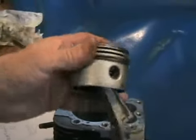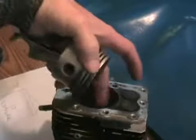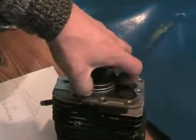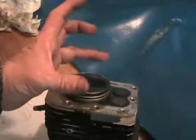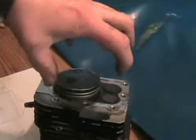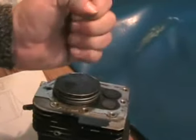Whenever reinstalling a piston in any kind of engine, lubricate all these moving parts, lubricate the wrist pin with motor oil, put some motor oil on the cylinder, and reinstall your piston. You'll need a piston ring compressor — some look like a pair of pliers. If you want a redneck method, you can use a big hose clamp. Another method looks like a toilet paper roll — it's a band of thin metal strip that tightens with a ratchet clamp, squeezes the piston, and pushes the rings in. Then gently tap the piston with the wooden handle of a hammer to knock it in.